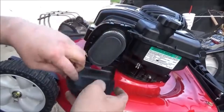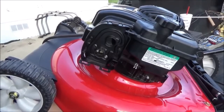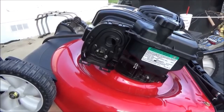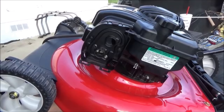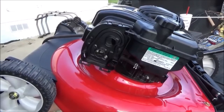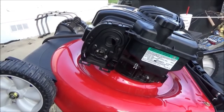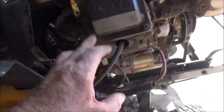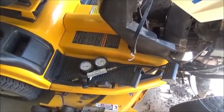Pop the air filter off and we can hear — I'm going to spin this motor over. So we have an abundance of air coming through the carburetor. So when I'm turning this engine over, that's telling me that the intake valve is not closing. Make sure the cylinder is in good health — no blown head gaskets or burned valves from it being too hot. I went ahead and did a leak down test and I want to quickly show you how to perform that test.